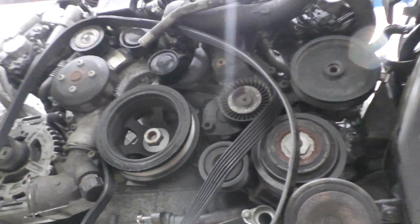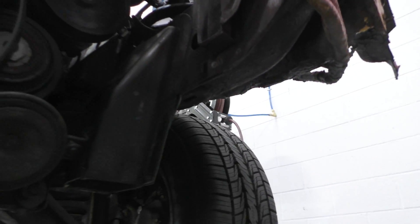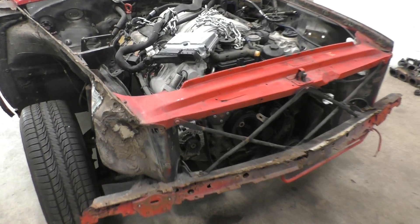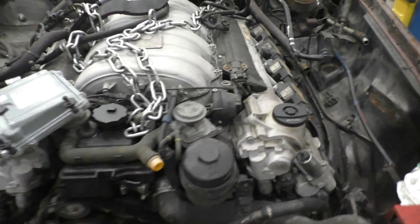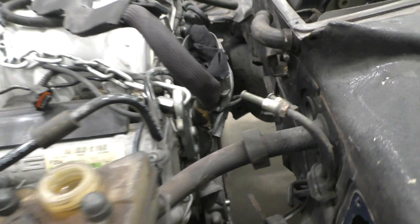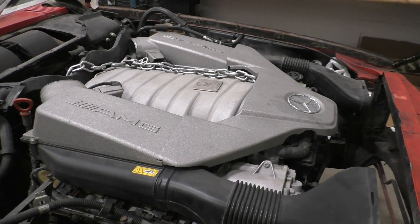Here's how things look from the front — we do have enough space for all the radiators, but we need to widen the chassis because the radiators are much wider than the chassis is right now. From the top view with the engine at its proper height, it's low enough that the hood will close and nothing will hit anything. The best thing is the transmission lines up almost perfectly with the transmission tunnel, so hopefully we won't have to do too much cutting there. That's how far we're getting for this video — the engine is in the car finally, but not properly secured yet.